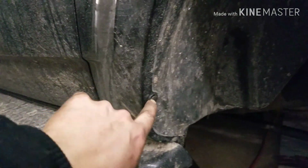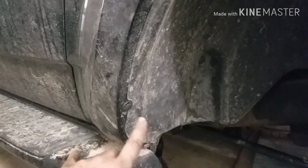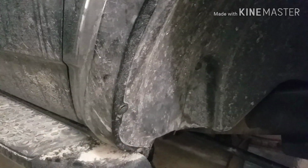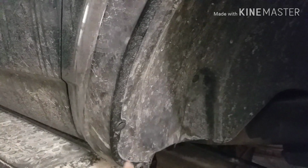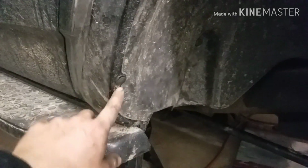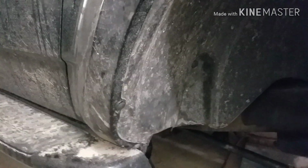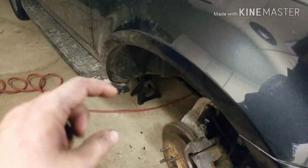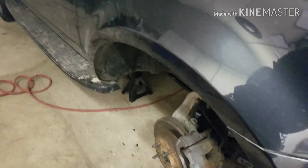And for these little clips, the clips that they have are almost like a rivet style, and they're one-time use, and then you have to punch the center out of them. I'll show you guys that in the next video. I have a bunch of other clips, so all I did was drill these out a little bit and then use these little push clips that are multi-use. They're the same as the ones on my 200. You basically just pull the center out and then get the thing behind there and they pop right out.